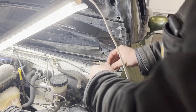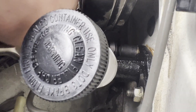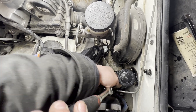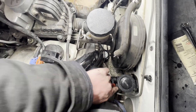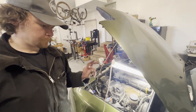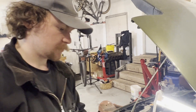We can just throw our nuts back on and go ahead and snug them up. You don't need to go crazy tight — just nice and snug so they're not going to come loose. Then we can take off the protective cap. We'll want to do a quick bench bleed, which basically just gets the cavity where the plunger rides full of fluid, or else we're going to be pumping forever trying to get fluid down to the slave cylinder.